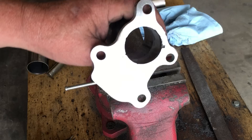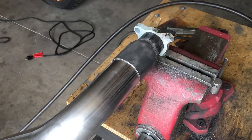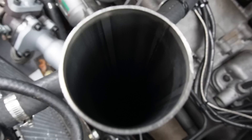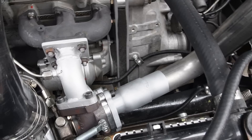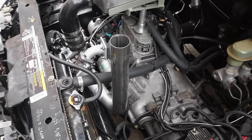We finish off the rest with a hand file — that didn't take long, and it's starting to resemble the part we need. A few more tack welds hold the pipe in place. We're only tack welding this together because it only has to work long enough for today's experiment. The up pipe is mounted to the turbo, and it looks alright — certainly good enough for the Saturn. The up pipe is stainless steel, and the rest of the regular steel parts were coated with VHT high temperature paint, which seems to hold up surprisingly well to exhaust temperatures. Now all we need to do is put a hole in the hood and we're done.